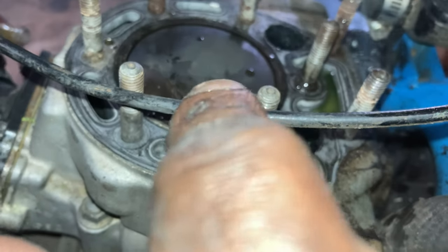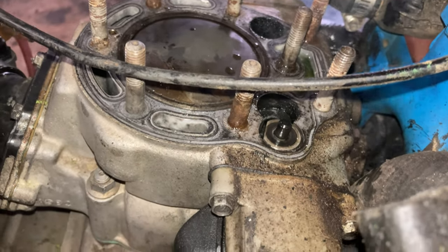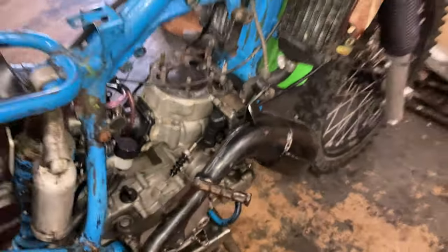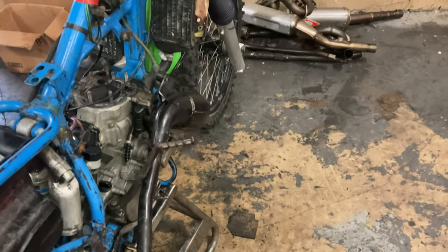You can see there's water on the piston a little bit, so we're just gonna seal those o-rings up because that's what's causing it to do that — coming out the overflow hose. We're gonna seal that up and go from there.